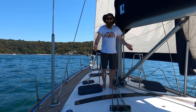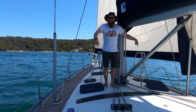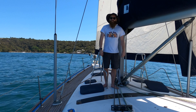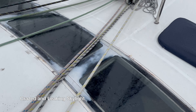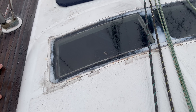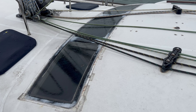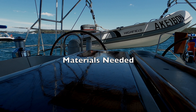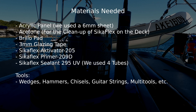You may be thinking why we're replacing the skylight. The reason is because 20-something years ago when Beneteau made this boat they made it out of one sheet of plexiglass and then glued it in place. This is great when the boat's brand new but after 20 years of sailing and flexing the corners lift, which then means the cushions inside get wet. That's no good. After 20 years in the sun our skylight was leaking, crazed, and it looked a little bit sad. We saw online that other 473 owners have replaced the single sheet of glass with three separate ones and that's what we'll be doing today.